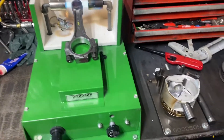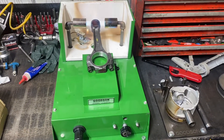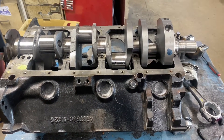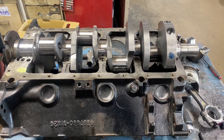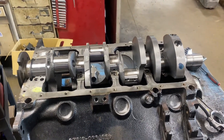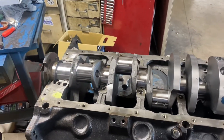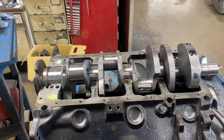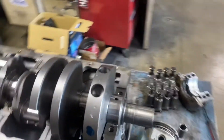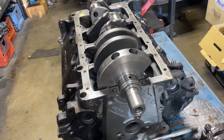Heating up the rods to fit the pistons in the 318 — we're switching rotations. What I want to talk about now is piston thrust. There's another video on my channel where I talk about this in detail on a Chrysler, but this is also a good review as I document how to change this particular engine and many others from left-hand rotation to right-hand rotation. Left-hand rotation is for automotive rotation engines — clockwise from the front — and opposite rotation is counterclockwise from the front.